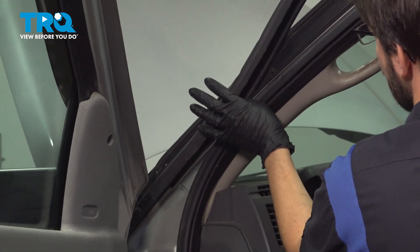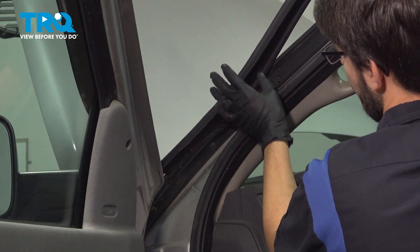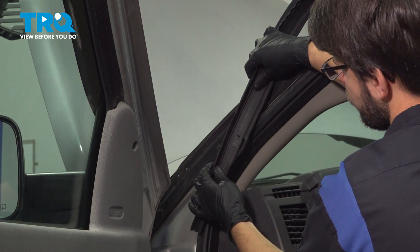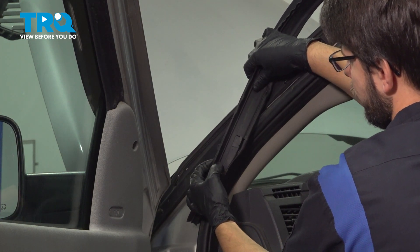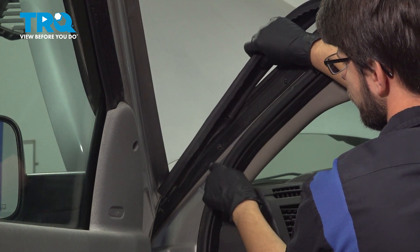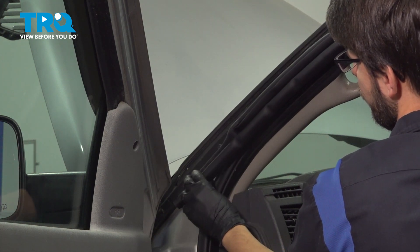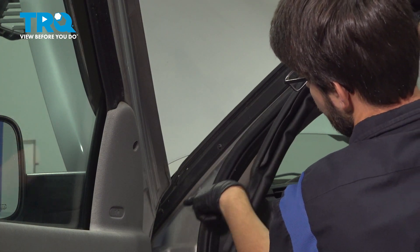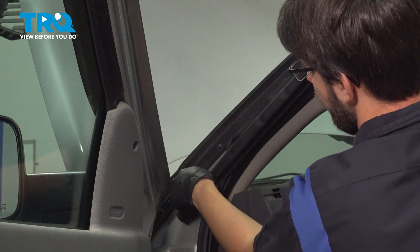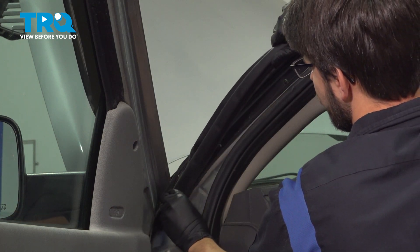When we lay down the new seal, first of all, I cleaned this track up so that it doesn't have any debris preventing it from sealing up all the way. And if you flip it over, you'll see this track here that is reinforced with metal throughout it — that's what's actually going to clip onto this lip here. One end of the seal will be tapered down to a thinner diameter because it actually has to go all the way into the fender a little bit, and this raised area will actually line up with the windshield seal.